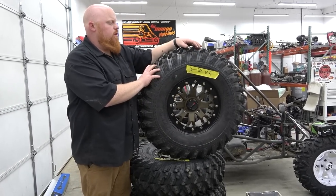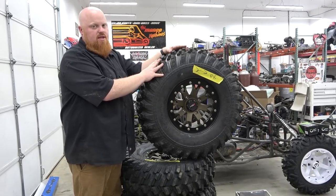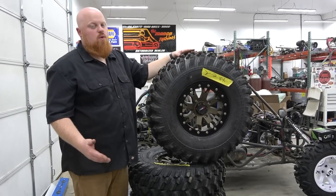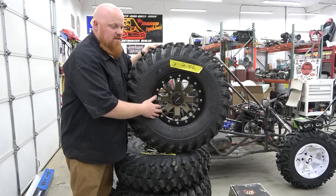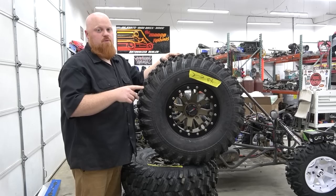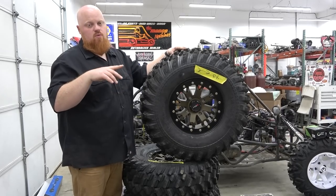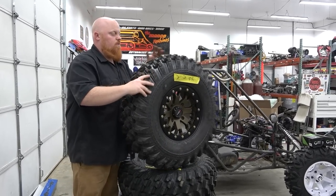We went with the Super ATV Warriors — these are a directional all-terrain mud tire. I went with the harder compound because of what we ride on; they wear a little slower and we don't ride in a lot of places where we need sticky tires. I went with System 3 beadlock wheels in 14-inch instead of 15s because I want more sidewall. These have a 4-plus-3 offset in the rear and in the front I went with a 6-plus-1, which is around stock. The rear offset is going to push us out to be even with the front. These are directional, so this one is for the passenger side.